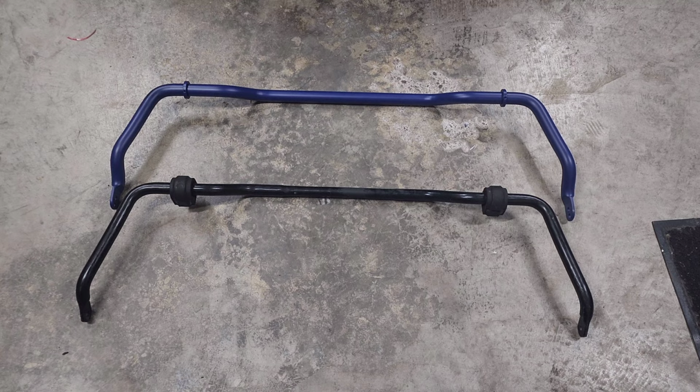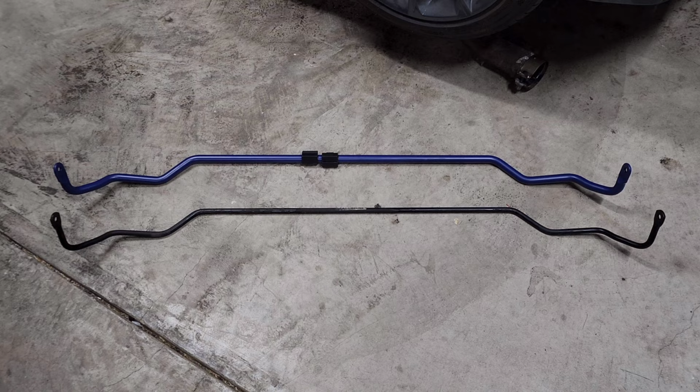And the other thing was my H&R sway bars, and this is going to help me not have to be as patient going through turns, because the same way that I had to wait to get on the throttle, I also had to wait for the car to settle in the turn. So with turns coming really sharp, I would have to be really patient, kind of take them a little bit wide, realize the car's just going to rock a little bit, there's no way around it, and then after it settled, then I could get on the throttle and accelerate and keep up speed.